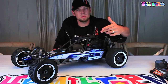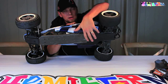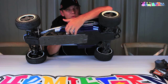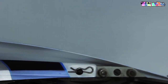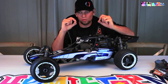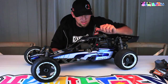So that's why I did not want to go for an under-tray. I did, however, want to close up the body with something that was easy to install. What I came up with: you use the stock skid plate with all the mounting points. Then I have this piece that closes off a large part of the chassis, and it's very easy to install — it hooks up to the front of the roll cage. Pull the two pins out from the roll cage; there are two thin plastic rings sitting there. Take those rings away, push the Hemistorm Addict side parts over those two pins, put the body clips back in, and you're good to go.